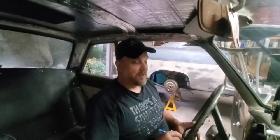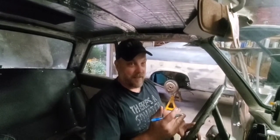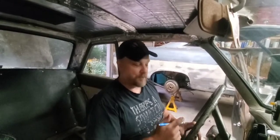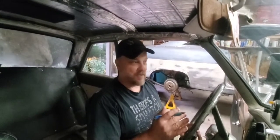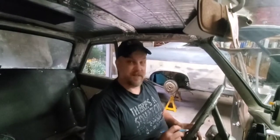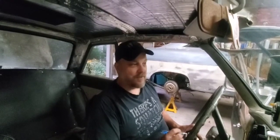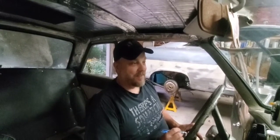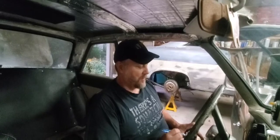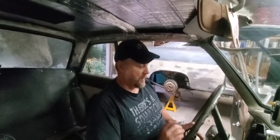Definitely a lot lower — about 1,500 RPM. I think I have it set at 1,050, and it's an idle where you can program it to run 400 RPM over what you want when it's cold. So I'll have to adjust that a little bit too, because now I see it's warming up here — it's up to like 1,650 now. And now that the idle is warming up, well it's still a little rich now. That compensation I made earlier to make it run richer is now a little bit too rich, but it's not too bad — good enough for now.